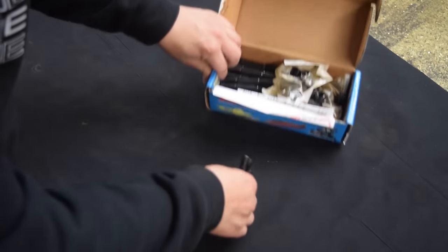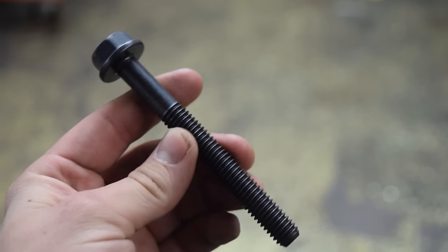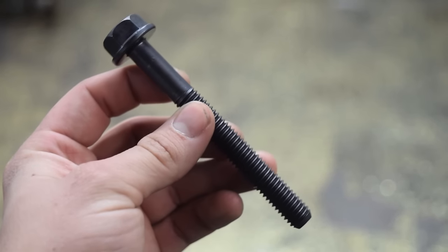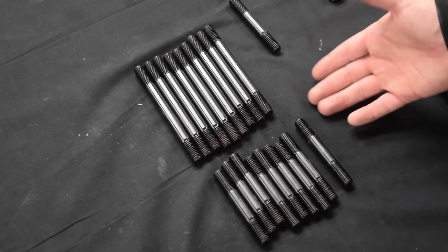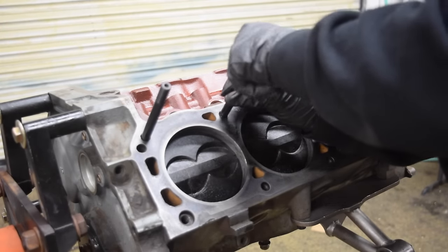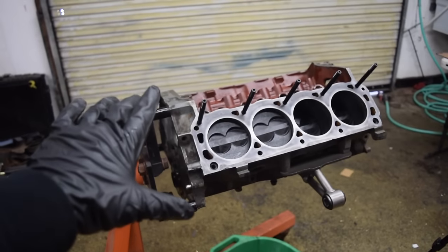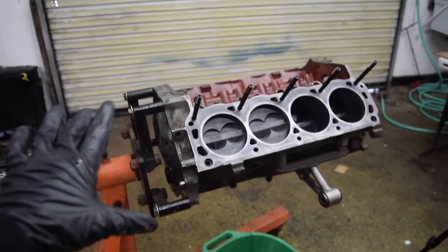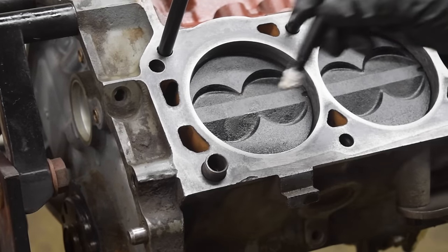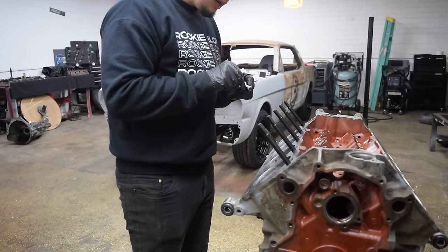Anyway, let me show you guys the new parts we have for the 302. There's a lot of opinions about whether we should use them or not, but I bought them and I'll tell you why. That is a set of ARP head studs. These head studs are meant to replace the traditional head bolt. A con of the traditional head bolt is that once they are torqued to spec, they cannot be reused. Head studs, on the other hand, are reusable and are typically used in high horsepower or boosted applications. Some people might say head studs are overkill for our application, and they'd be right — if we're lucky we might be pushing around 250 to the wheel, so I definitely wouldn't consider this a high horsepower application. But I didn't buy these because we're going to be pushing a whole lot of horsepower — I got them because they were 80 bucks on Facebook Marketplace. Now if we ever open up this engine again, we don't have to buy head bolts.